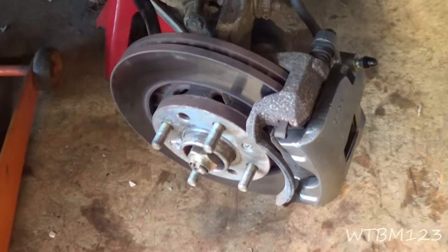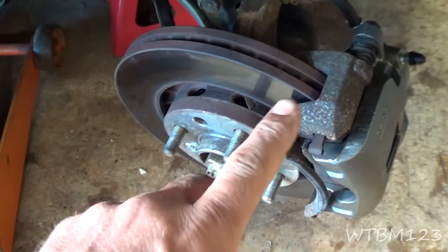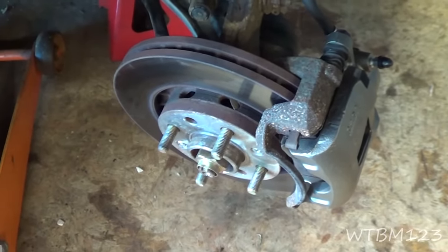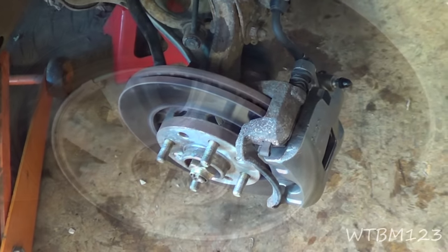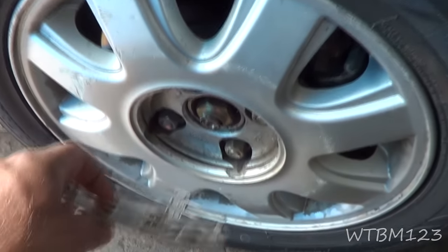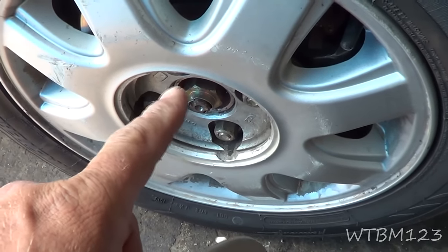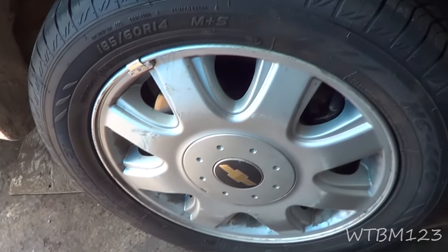Before putting the wheel back on, since we've been working with brake fluid, take some brake cleaner and clean the inside and outside of the rotor to make sure no brake fluid gets on the brakes. After the test drive, the brake pedal felt a little low, so I went back and readjusted the rear brakes, which brought the pedal up. The last thing I do after driving and rechecking the lug nuts is put the lug nut covers back on — that way I know I haven't finished with that wheel until that's done. That rotor, by the way, was off a '99 Lincoln Town Car. Thanks for watching.